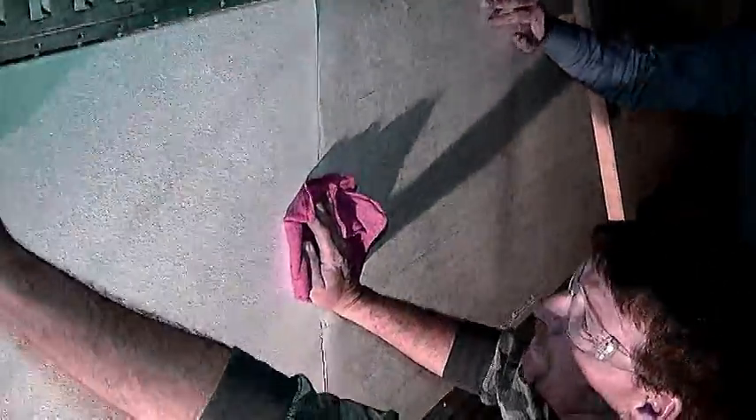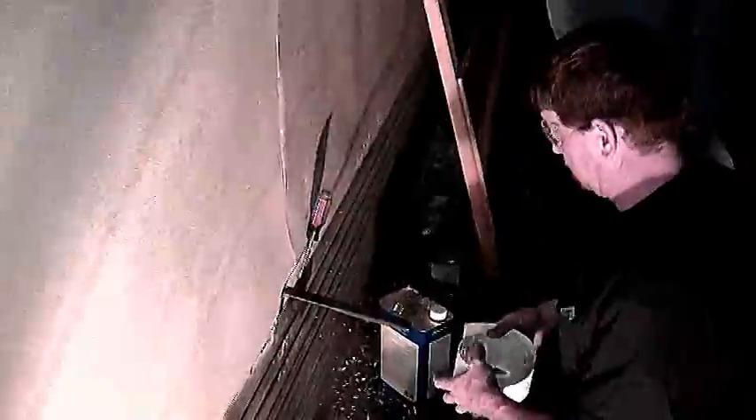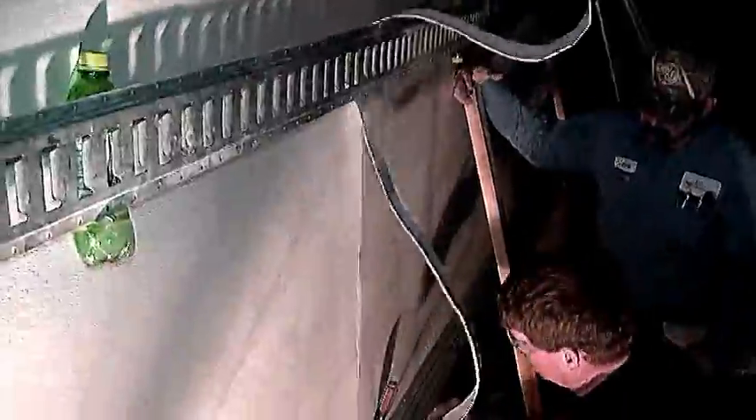The wall presses have been removed and now it's time to put the 3-inch tape on the edges. Before you apply the 3-inch Quick Patch tape, make sure the wall is very clean — all the grease and grime needs to be off of it. When you're putting on the 3-inch tape, work from the bottom and create a wedge space to slide the 3-inch patch inside the scuff plate groove, then work your way up to the top, smoothing it out as you go. Make sure you remove the E-track so that you can get the 3-inch tape all the way up to the slice at the top. Peel off a little of the backing for the Quick Patch and then stuff the patch down into the groove, making sure it's not sticking to the wall until you want it to.